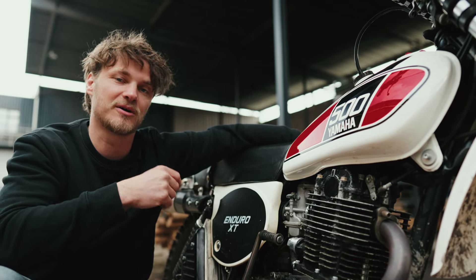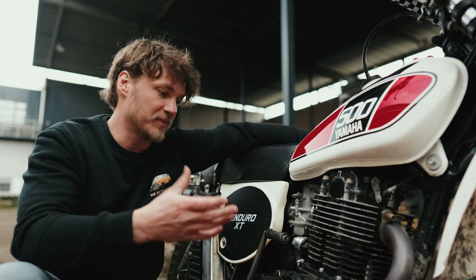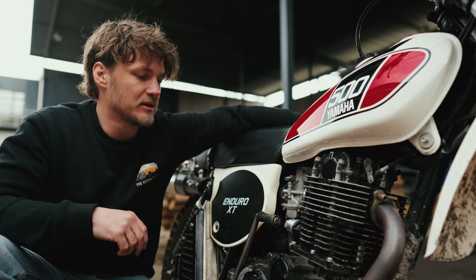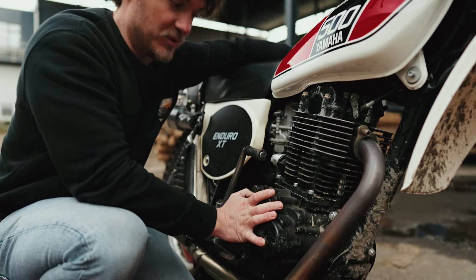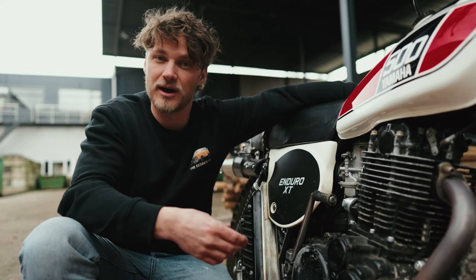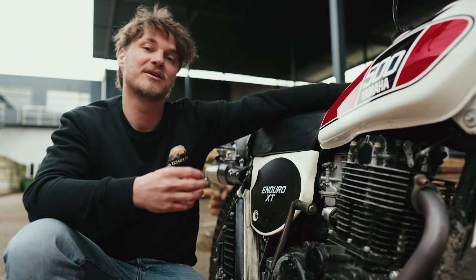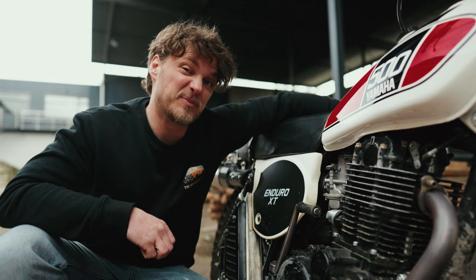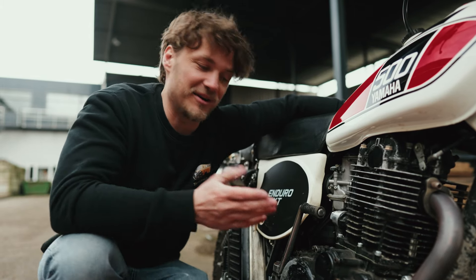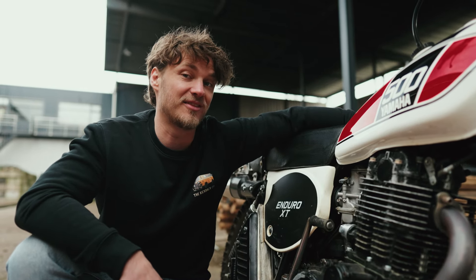If the valves are oval, when the engine runs at idle it can sometimes fall out and burst the inside of the engine the wrong way — so if you notice that in your XT, go check it out. Another known issue is the connecting rod — the push rod of the crankshaft. It has a copper layer around it, and the copper on the small end at the piston pin is known to wear out, causing free play on the piston pin, noise, and an unhappy engine. When revising your engine, take it apart, clean it properly, and check everything. If you're not familiar with this setup, find a specialist.